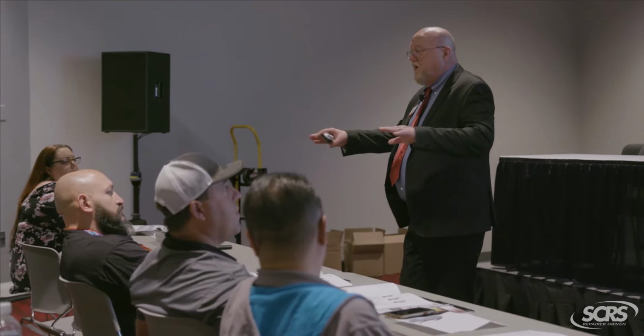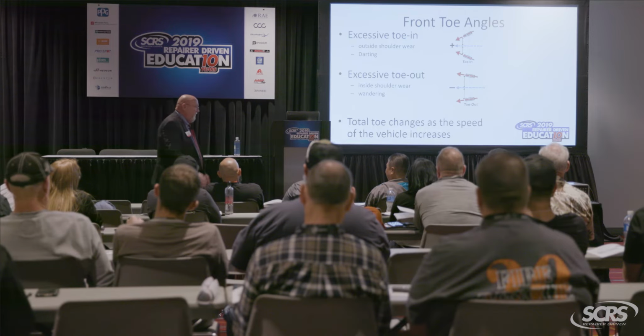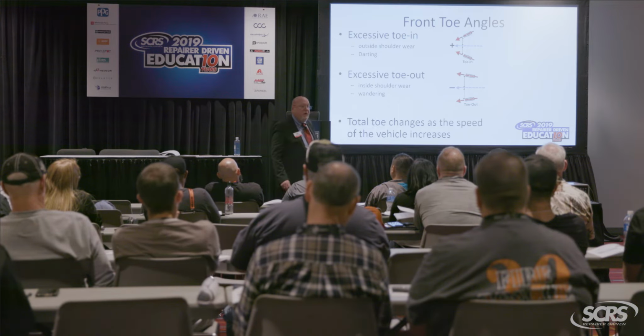Total toe itself will not cause a pull force. Why? Because your toe is always going to equalize. So anybody that tells you a maintenance toe and go is going to create a perfect car that will not pull again, that's that self-proclaimed expert coming out. Because toe always equalizes.